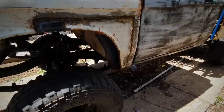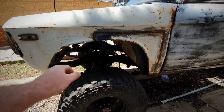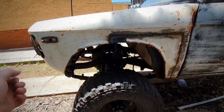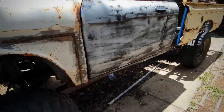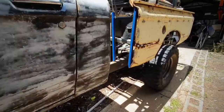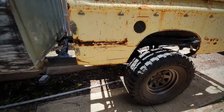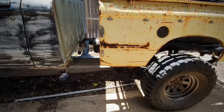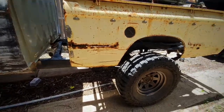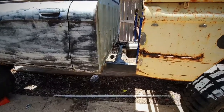I haven't quite decided on the bar work yet, but I'm thinking — because I need to do a wide body anyway — I'll build the wide body first and then do the bar work on the inside of the guards so you don't actually see it, but it still keeps everything protected. It'll be tied up neatly against the back of the guard, so anything that presses against the guard will just press against those bars.